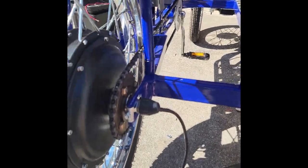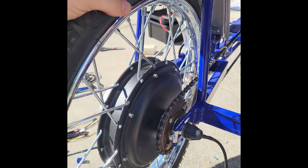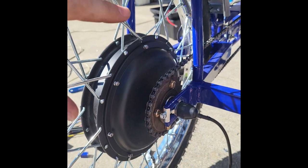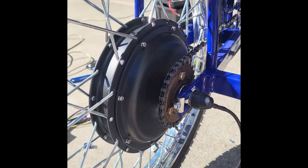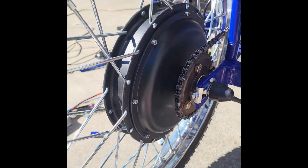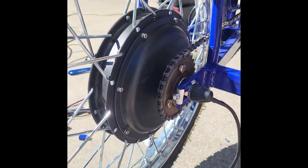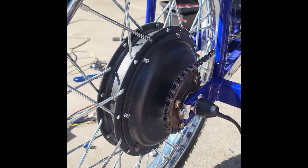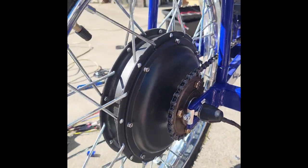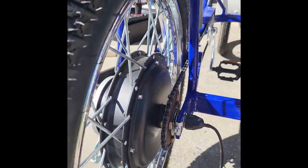With the wheel in, if you freehand spin it you can feel a little resistance from the motor — that's the electromagnet. An electric motor has a charge built up in the magnet, so you can feel that giving a little resistance. Once it's hooked up to the ESC speed controller, that can remove the charge so you won't feel resistance. The more you spin it, it just builds up a little charge from the magnets inside, but that's normal.